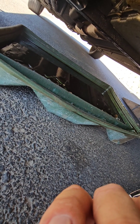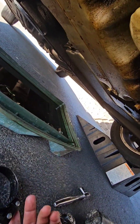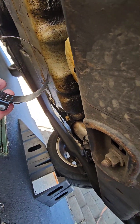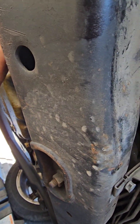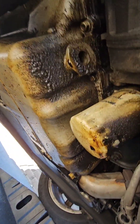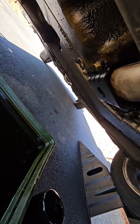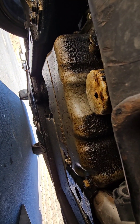I'll put the drain pan back in. I've got an oil filter wrench here, and hopefully I can put that on there and loosen this up pretty easily. Some of those get torqued on so hard you can't even get them off. Make sure you've got your drain pan underneath your oil filter when you pull it off, because it's going to be full of oil.